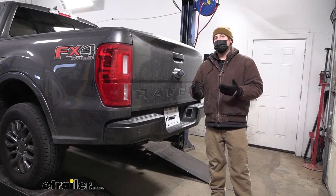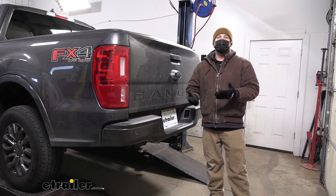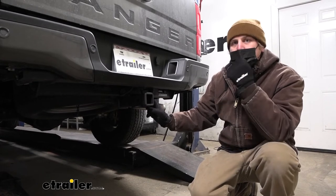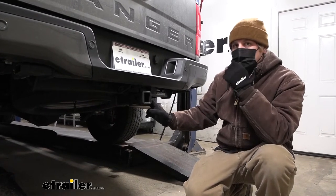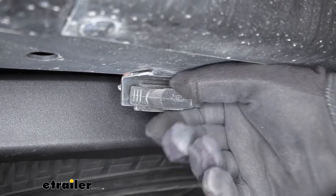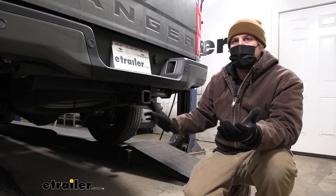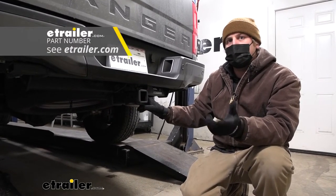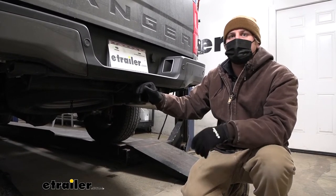I always like to suggest it's never a bad idea to grab your Ranger's owner's manual so you can make sure your Ford can tow that much weight safely. For those of you that plan on pulling some larger trailers around, a lot of times those trailers are going to have what's called a seven-way round wiring connector. I believe all of these Rangers, regardless of the package, come with the factory four-way flat type wiring, but obviously that isn't going to work — it's not going to plug into a trailer that has the seven-way. So if that's something you plan on doing, we offer a couple of kits here at eTrailer that are seven-way that you could pick up, install on your truck, and be able to plug into those different types of trailers.